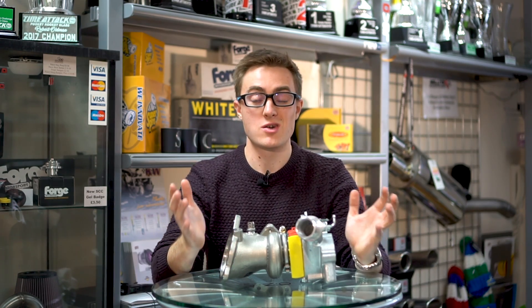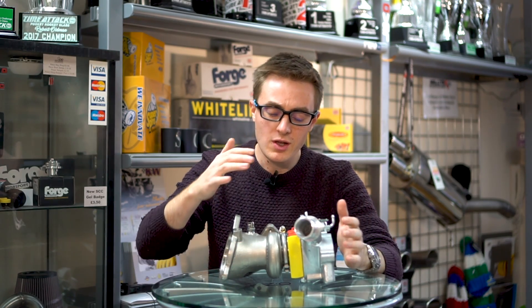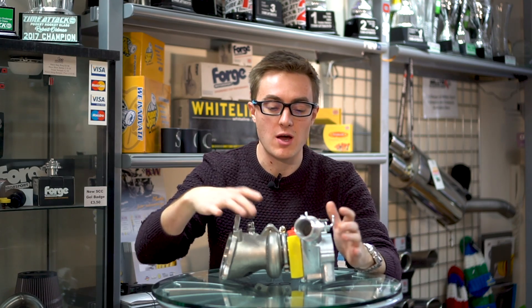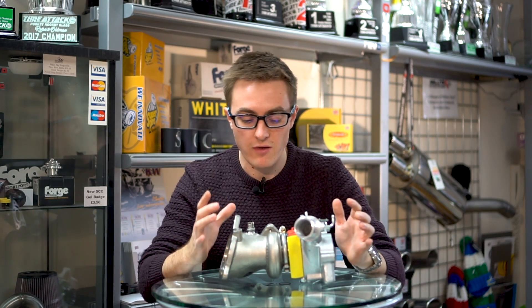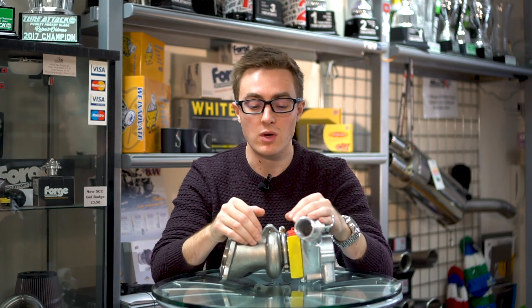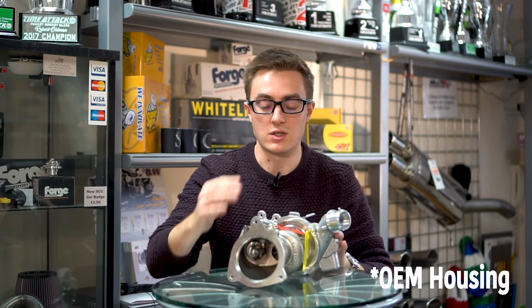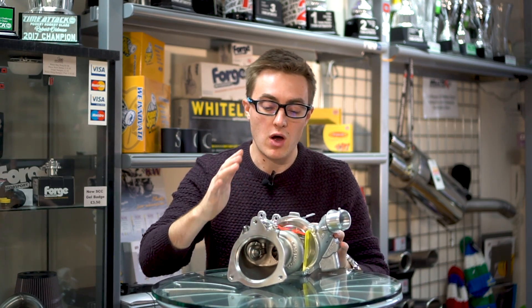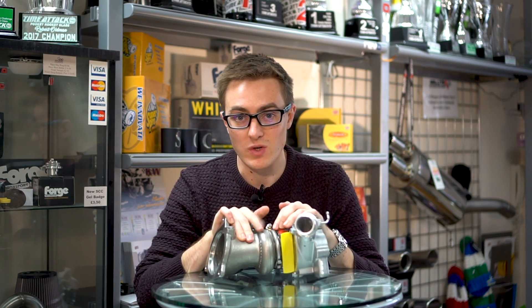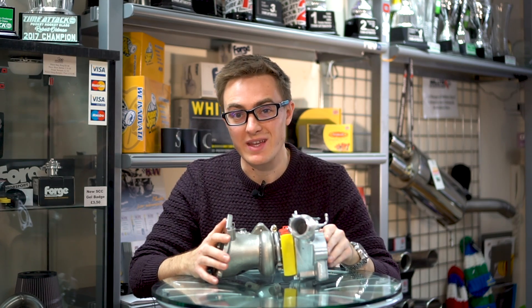Now obviously these are quite complex beasts, but for the sake of consumers like you and I, we can work off the principle that if you want more power out of a turbo, you enlarge the turbine and the compressor wheel. Up until now, manufacturers and tuners of all kinds have been modifying this turbo in order to fit a larger turbine and larger compressor wheel. And that involves milling out the custom housing of the compressor wheel and also the custom housing of the turbine side as well. But unfortunately there is only so much metal in this, which means really you can only produce 300 horsepower out of this before you run out of metal in the housing. So that's Revo's first challenge.